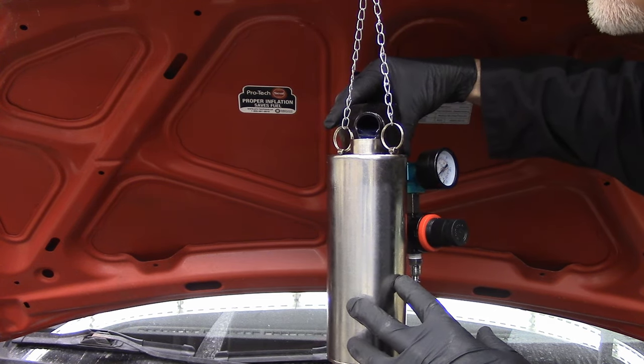It could be that if the injectors aren't flowing very well, it needs to add more fuel to get the right amount of fuel that it would have been getting had the injectors been actually flowing properly. So it's possible we can reduce this. 4.7 is not bad, but we're gonna see over time. I may check back and see if there's any progress, any difference on this.